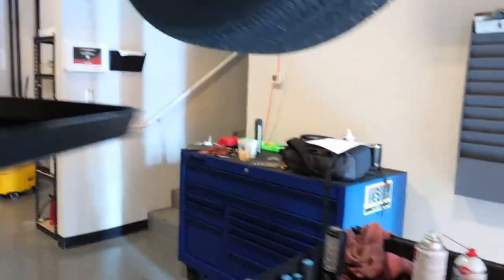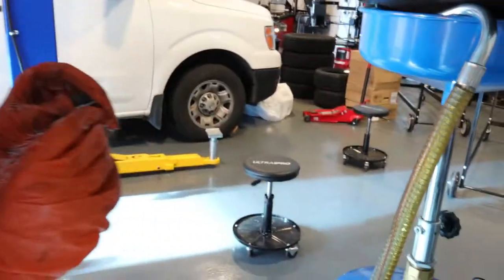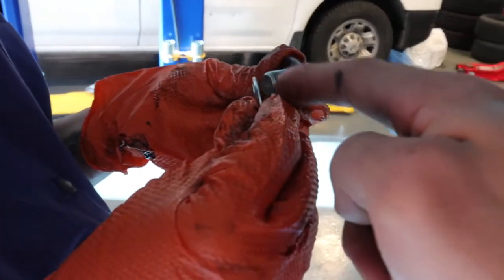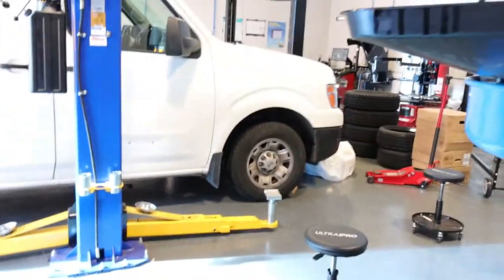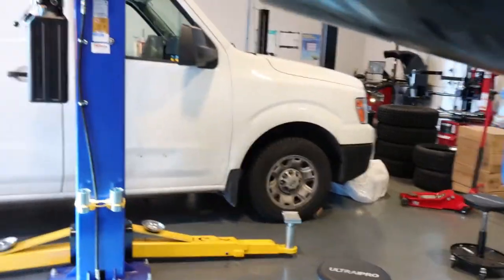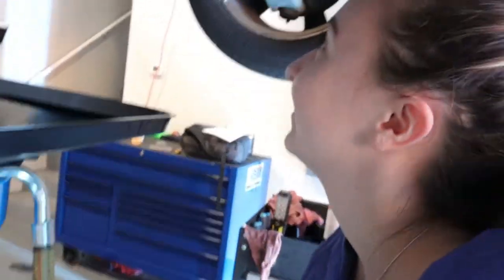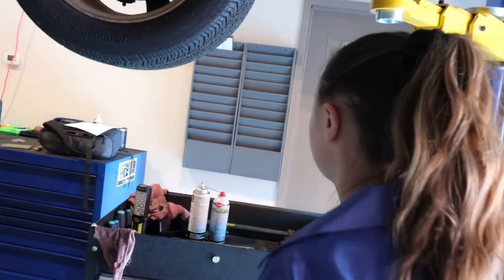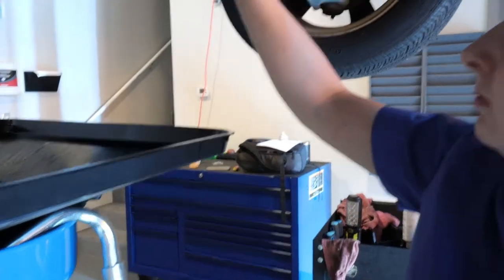Okay, so I pulled your drain plug. Cleaned it off here. So see how there's a washer on it? Yeah, that thing in your hand there? That's a crush washer. So you put it on there, and then when you put it on to your drain area again, you're gonna wanna make sure that gasket is centered. It looks really centered. Look at me go. Yeah, way to go. Okay, so you grab your socket and wrench again, same size. This way. Yep. Now you're gonna tighten.